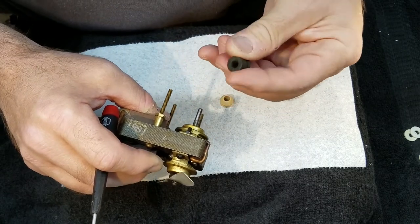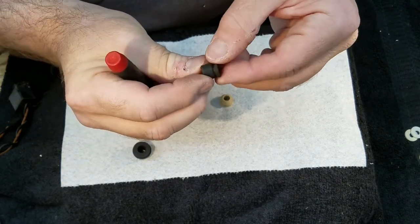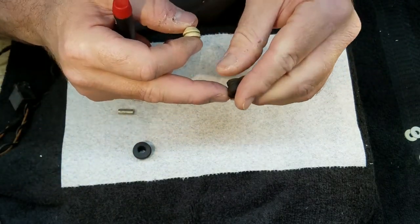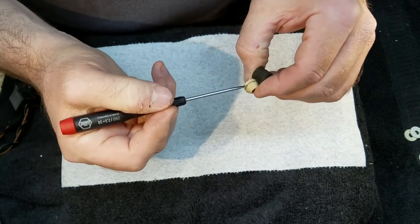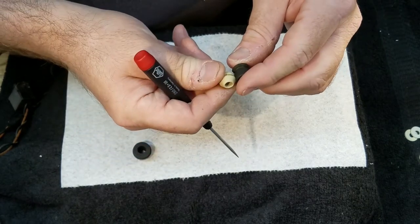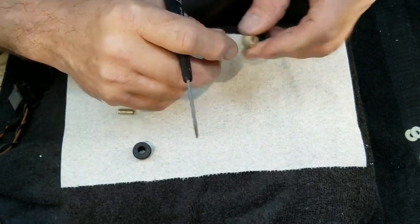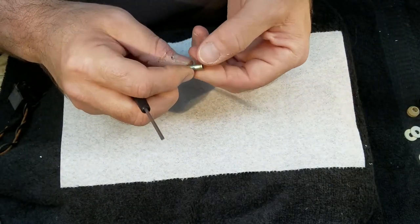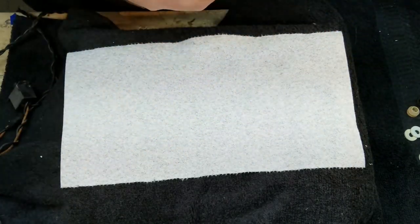I think it's going to work. Looking closely, two of these original mounts are in really good shape and are reusable - only one of them is hardened and not reusable. So what I might do is use one of the new ones and these other two originals. Since that height dimension doesn't matter, the rigidity from two of these versus three should help firm up that motor. It may sound like convoluted logic, and maybe it is - but we can always take it apart and try it the other way. Let's get started mounting this motor into the record changer base plate.